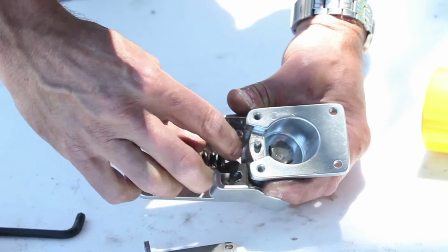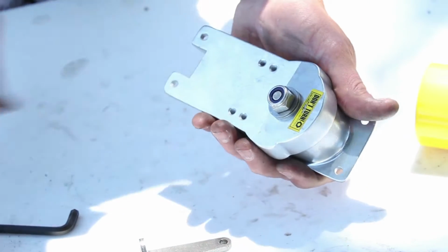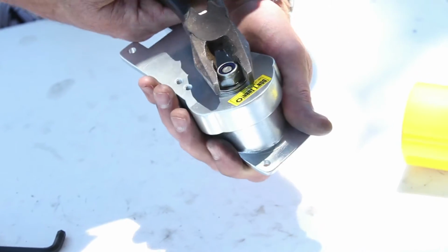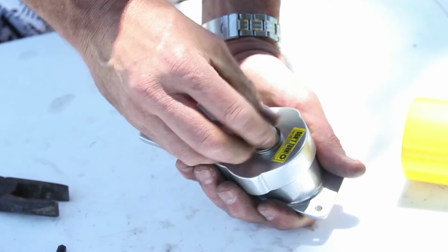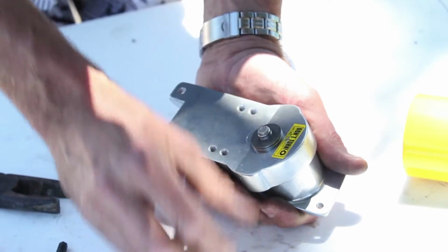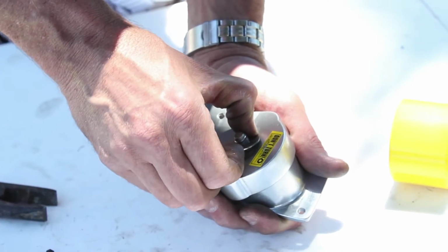So let's turn it over now and look at the all-important bolt. This is the one that has a sticker that says "Don't turn." Obviously, to maintain the thruster, we need to loosen this bolt and take it off. Just be careful with the spring-loaded washers you'll find with it. There's 2 washers and also 1 cylinder bearing.